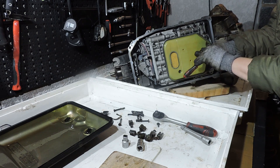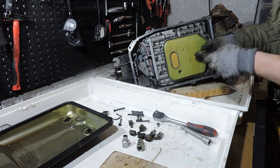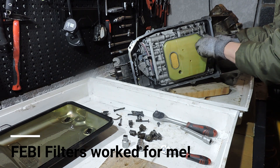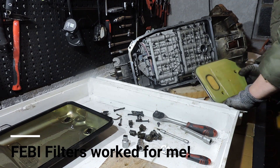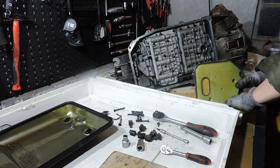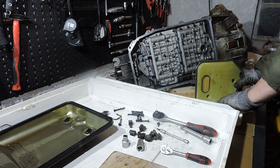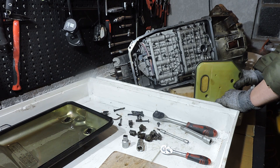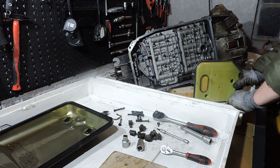To remove the filter, use the Torx 27 again and remove the three bolts holding the filter to the valve body. This is an original Filtron filter — the brand ZF used and BMW still sells. Whether you order from ZF or BMW you should get a Filtron filter. There is also a brand called Febi. Many people say you should not use a Febi filter and should stick to Filtron. However, from my own experience the 5HP18 takes Febi filters really well. The 5HP24 and 5HP30 don't — for some reason they want the original filter. I have driven this gearbox after the rebuild with Febi filters and it did just fine — no noise, no whining, no oil starvation problems. For the 5HP18 I dare to say Febi filters are fine. For the 5HP24 and 5HP30, I would stick to the original Filtron filter.